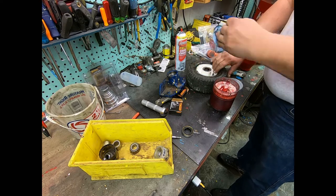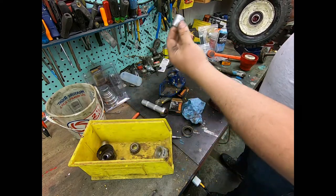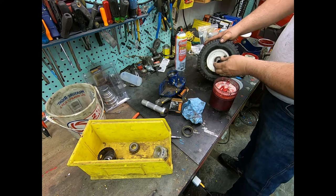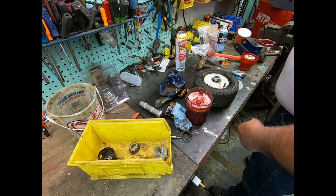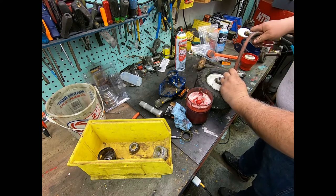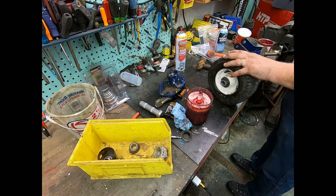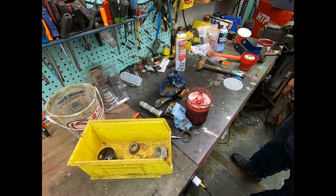Give it a quick wipe to remove any excess grease that squirted out. We're going to put in our wheel spacers — I cleaned them up on the wire wheel the other day. Put both of them back in. While we've got the front wheel sitting here, we're going to check air pressure — usually about 30 PSI, and this one had 20. There we go. Front wheel is done. We can put this to the side and wait till we assemble the front.